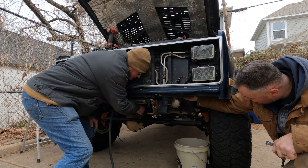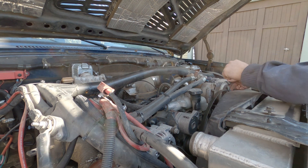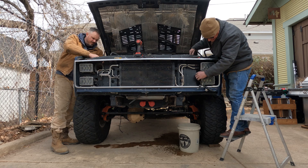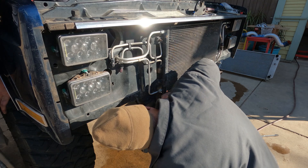Since the engine was locked, it means we can't rotate it to access all the way around the flex plate, and so the torque converter had to come out still attached to the engine. It's not a huge deal, but it means you have to pull everything forward several more inches than you would for an engine that could still spin. It kind of creates a mess, too.